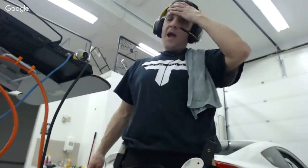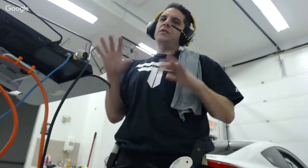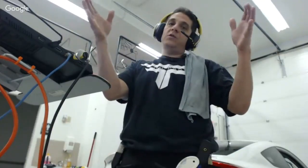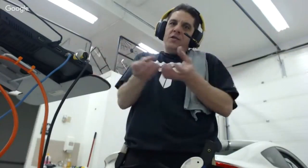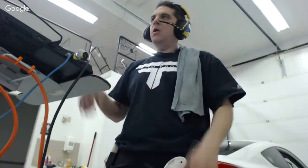You'd be better off practicing on something. If you know the person and they know you're learning, and take some precautions, take your time, clean the glass right, cut that back window with a real tight tolerance, the side windows as well. They have a real tight tolerance. A lot of water gets puddled up in the bottom section of that particular side window, the side windows in the back there. So you can take paper towels and stuff them in afterwards to dry up that moisture.